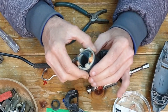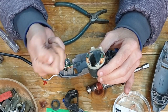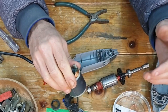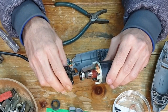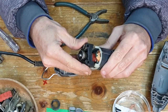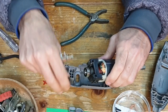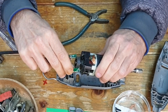What I did basically is re-slit the wire into the small clips and then gave it a little bit of a tug, a little bit of a pull, which severed the wire from the other end. Everything now looks to be connected and I'm reassembling the entire unit - putting the shaft into the coils, putting the switch assembly in, making sure that each pin goes into its corresponding place so there's contact all around. Don't forget to put in the rubber bushing.